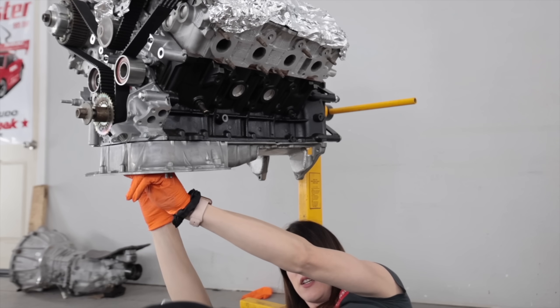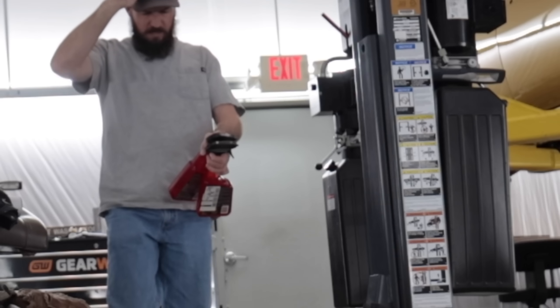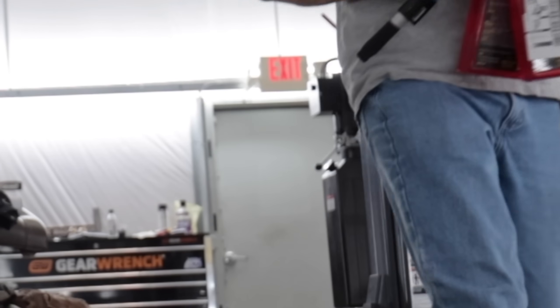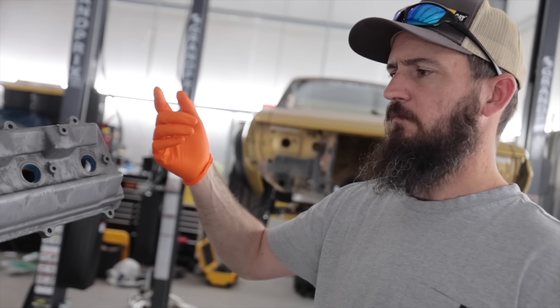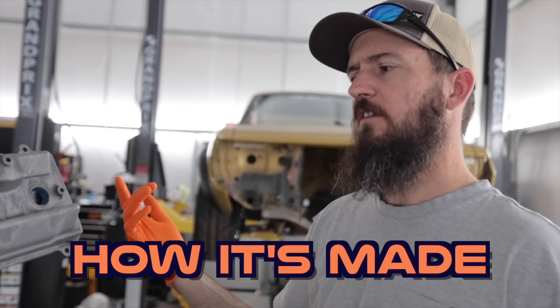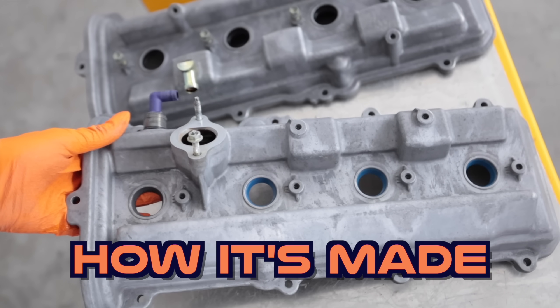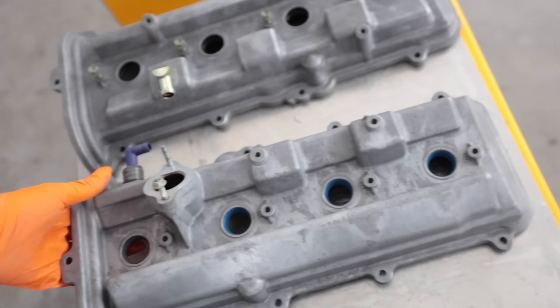I hear a power stroke — that sounds like a Charlie. Called it. This is Hot Rims chrome wheel cleaner. See how it's got that marbling? I think it's artifacts of the die cast process because the mold for die casting is around 250 Celsius, which is hot, but it's way colder than molten aluminum. So when they pour it in there under high pressure, you get lots of turbulence and sometimes these surface discolorations. I was telling Charlie that I've literally thrown every single chemical I had at those valve covers and he wanted to give old mag wheel cleaner a shot. Boom — yeah, that's the old mag wheel cleaner they stopped selling. Discontinued.